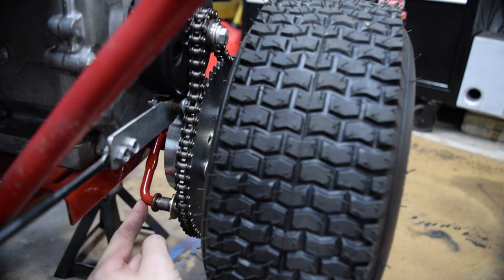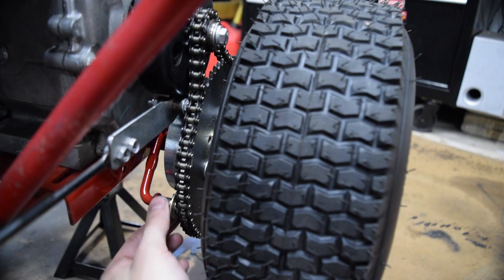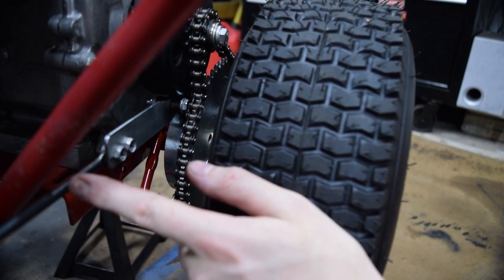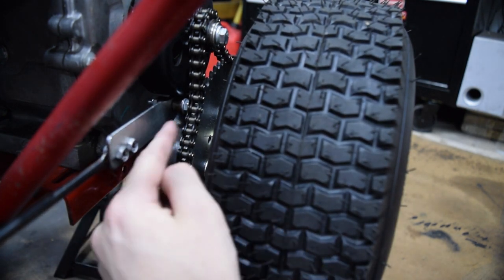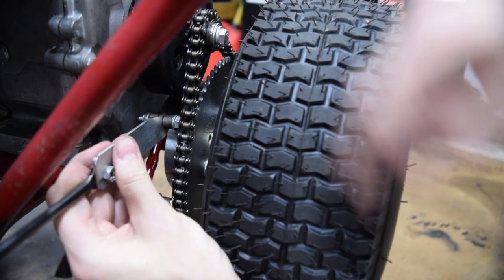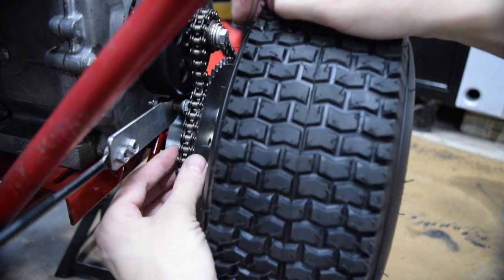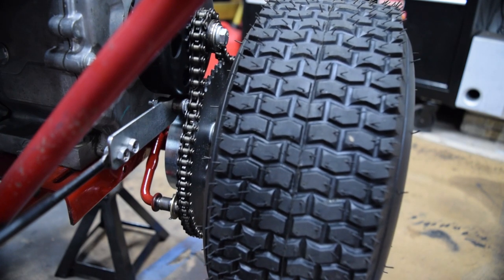This arm is the one I made — I cut up the blade engagement arm, which happened to be the same diameter as the interior diameter of the brake shoe and already had a cotter pin hole in it, so that was perfect. I just cut it, welded it onto the axle, and painted it to match. Up top, this arm is the original brake arm. The new brake cable ended up being about four inches too long with no way to shorten it, so I made a little adapter that bolted to the original arm and attached straight to the top of the brake shoe. I also had to clearance a lot — the bracket was touching the clutch and a bolt head had to be ground down so it wouldn't hit the sprocket. The new sprocket arrived, got installed, though the holes weren't drilled properly and I had to open them up to get them to line up — wasted a solid 30 minutes.